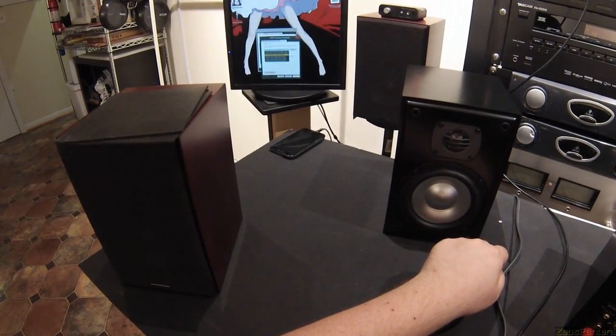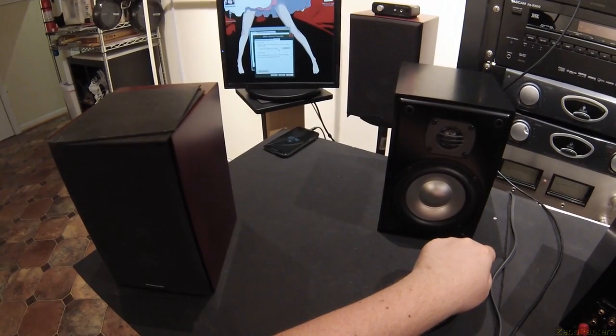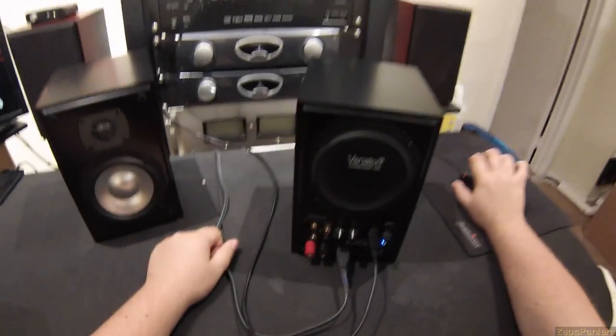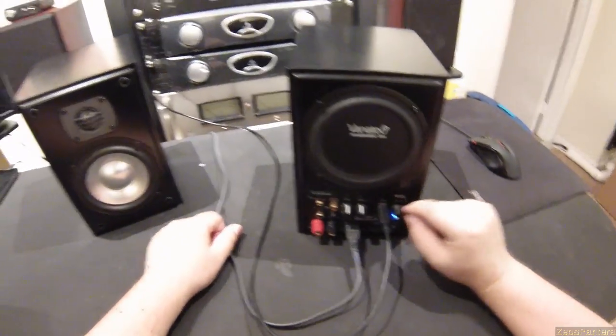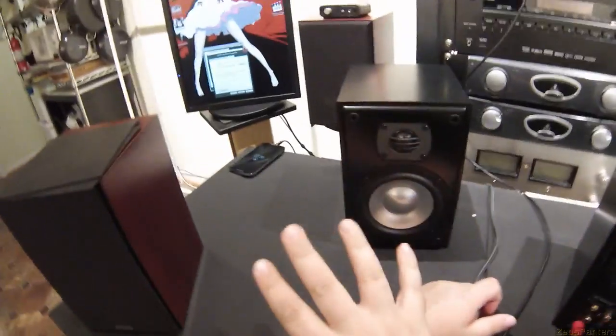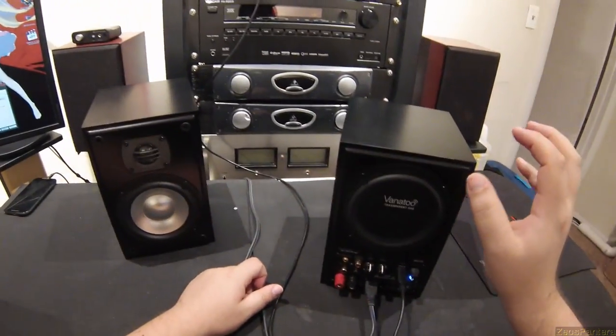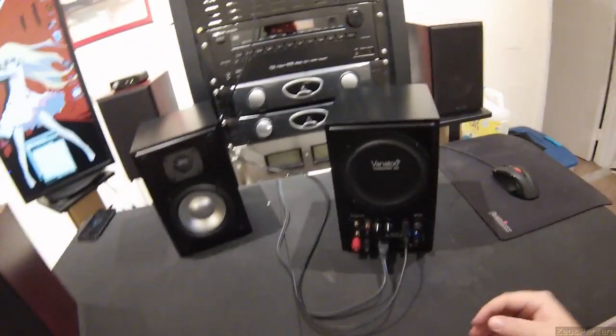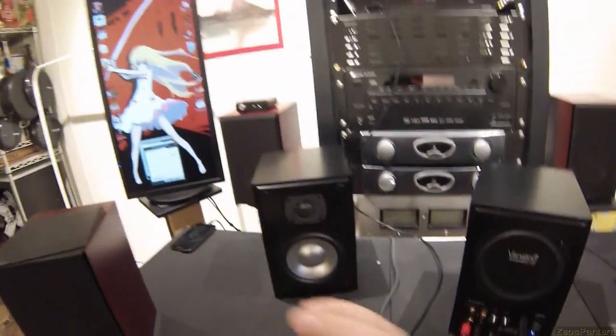SPDIF, 2-channel, 16-bit. Let's take it to 24-bit because we're nuts. Actually, we're taking it to 24-bit for this particular reason. No one wants to reach back and use the volume knob behind a speaker. I never want to reach back there. The higher you have the bit rate set, the better sound quality will be when you lower the volume on your computer. When you use the massive volume keys on your keyboard, or you lower foobar's volume, it doesn't.